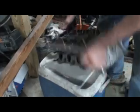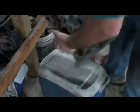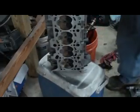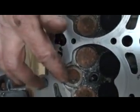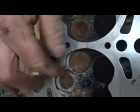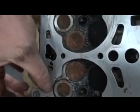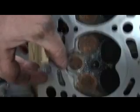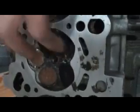Spare cams. Over the other way. Okay, these are the valves that typically bend the easiest, is because they're so close to the piston when it comes up. These are a little bit farther away. I'm going to say there's 10 thousandths of material before the valve right there. There's 30 or 40 thousandths worth of material here. So you can be a little off here and it won't hurt.